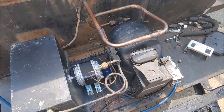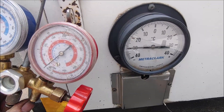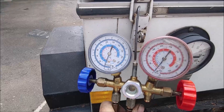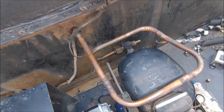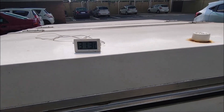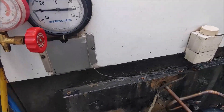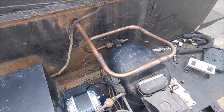This compressor has been running for a while out here in the sun. The temperature is just about 30 degrees below zero Celsius. Suction pressure is about one pound above vacuum, so the compressor is running pretty low. Everything seems to run nicely, the suction is cold. Our ambient temperature in Johannesburg is now 31.3 degrees — so there's about a 60-degree difference between the room temperature and the inside of this freezer. I think if we leave it running overnight it might drop another couple of degrees, but I think it's working fine.